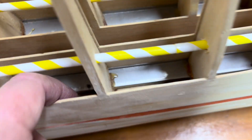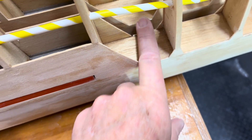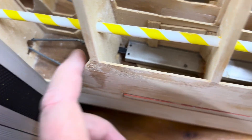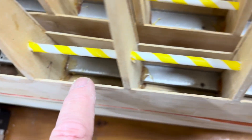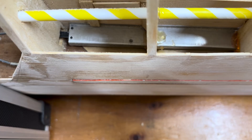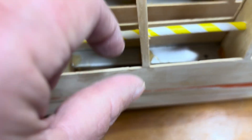I'm not really certain how to get in there. If I lock this up it's just going to put a stress riser in here and cause it to split even more. That's a solid plywood web there — not going anywhere. You can see the web finishes there in plywood and then the balsa starts and comes along here. I really need to get something in behind the spoilers. I wonder if I make short narrow pieces and feed them in and rotate them one at a time — I'll ponder that.